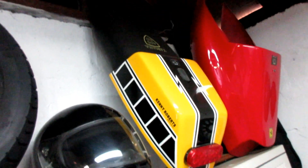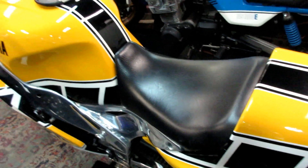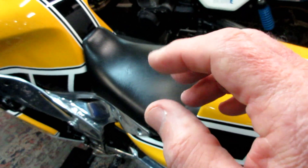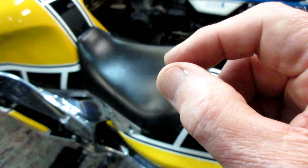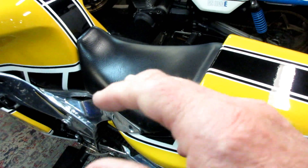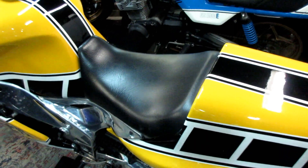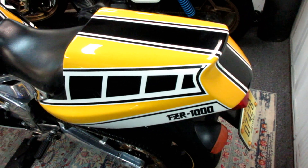When I made the RD cafe seat I took foam rubber out to make it lower. Important information: vinyl comes two ways — vinyl made to stretch and vinyl made not to stretch. If you buy vinyl you want the stretchable vinyl. I once bought some that looked like leather for a Ferrari-colored bike and it was impossible to stretch, so I had to recover it with black stretchable vinyl. That vinyl typically costs about nine to ten dollars a yard; Luciano just bought a yard for 25 bucks — it's a new world.